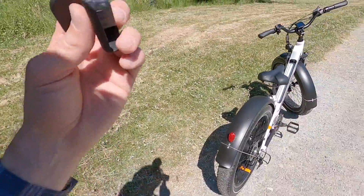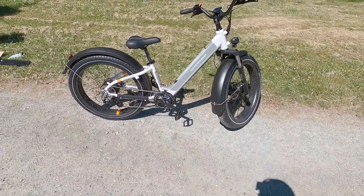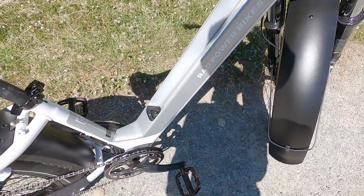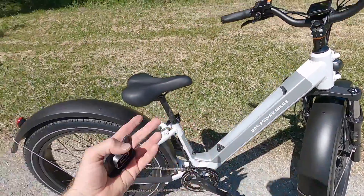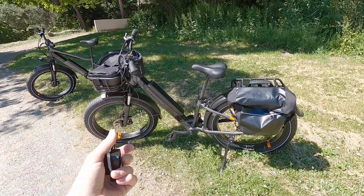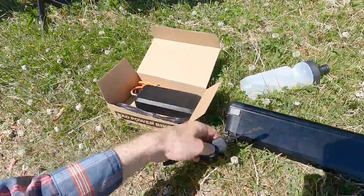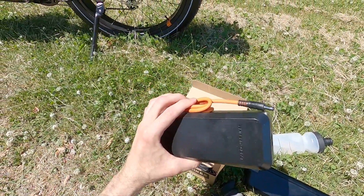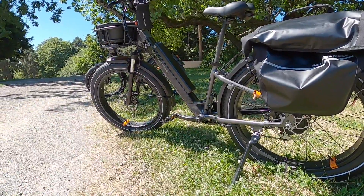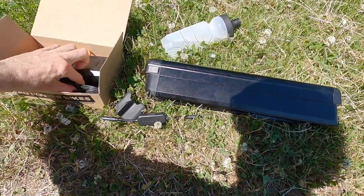There's a cool accessory cover for the battery connector to protect it from dust and debris when hauling the bike on a car or RV. The battery weight is kept low and centered. You get a universal charging point — no dongle needed, which means fewer things to get lost. The new charger has an orange wire, weighs about 1.3 pounds, and has the same 2-amp fill rate, so it might take six hours from empty. Ideally keep the battery between 20 and 80% to maximize lifespan, and store at 50% if not using it for a while.